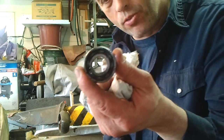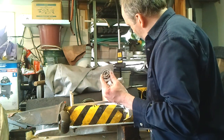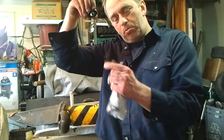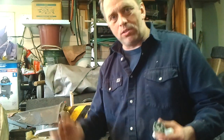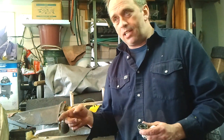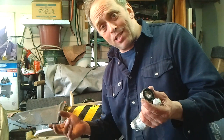Just to show you the grease, it's there, but it's getting dry. So by putting only one seal, you put the seal on the top like this, and the one seal you remove on the other side, so the grease does touch those bearings. So just a quick video about it. I mean, it's common sense. And the guy was also saying it's not only John Deere, Husqvarna, all those mower decks, they're basically built the same way. So I'm gonna try that this summer and let you know